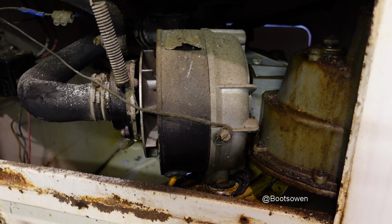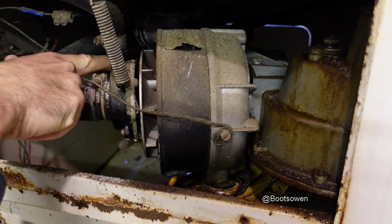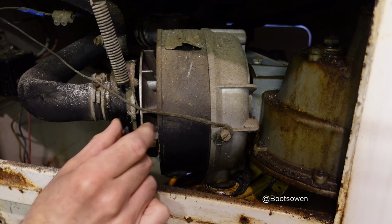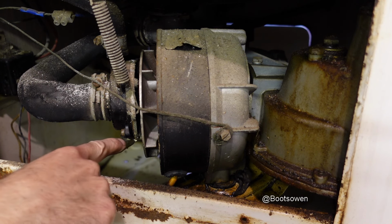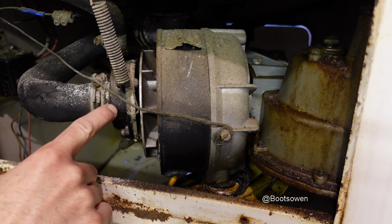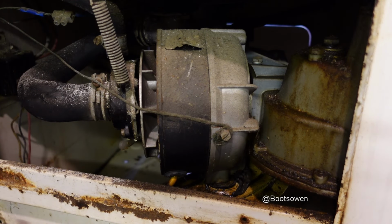So in here you've got a big motor. You've also got a pump unit on the end of the motor, and there's a lever handle here setting off into the distance. To use the pump, you have to open the door to the bottom cabinet and slide this pump in, and I think then it's a friction drive off this flywheel or off something else inside. There's a drain plug there on the bottom of the pump. This is the rubber hose that the sump drains into, and then the pump shoots it out. It's like a modern washing machine pump, except I think it's made out of aluminium or something. There's a rating plate or a sticker up on top of that motor there, but I might vacuum it later.